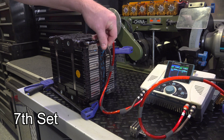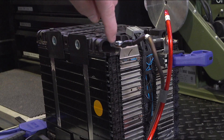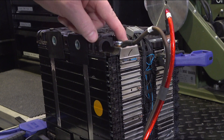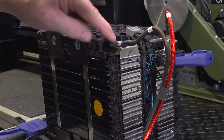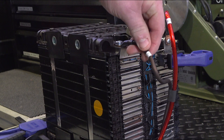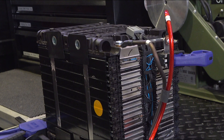The last one is a little difficult — not really enough contact area there. You can just take the terminal off and bolt it right to the battery itself. Might have to enlarge the hole in the terminal lug, but a direct connection is always the best whenever possible anyway.